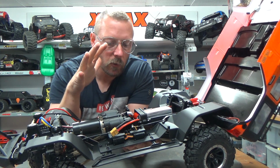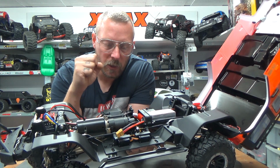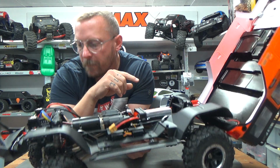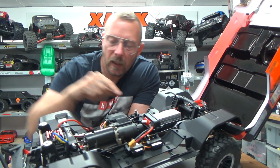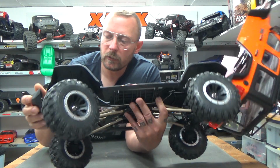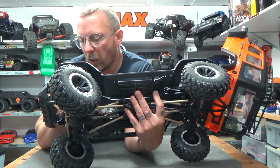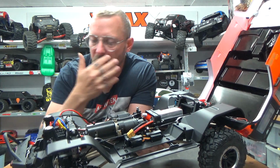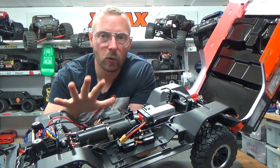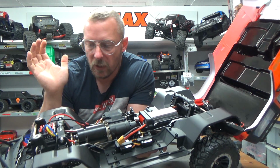But think about it, if you drive slow and if you are demanding hard pushes on the motor, there is a point where the amps go high. You can switch on the ESC, not LiPo or NiMH, but you can switch if you want to have brake or no brake or automatic brake, that stuff. That's all in the manual. If not, you can go to the Hobbywing website and check out the QuicRun 4S brushed ESC.